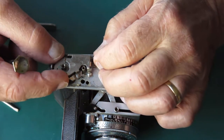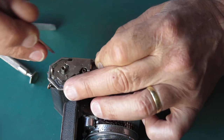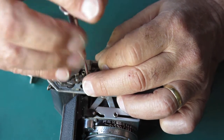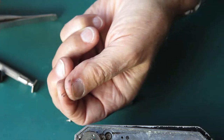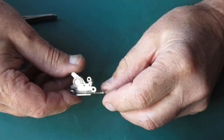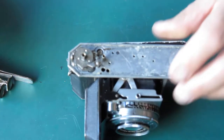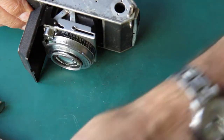Let's pull that back so I can get to the three screws that hold this bracket in place. That screw head looks a little bit damaged and it's loose. There's a shoulder screw with a return spring on it which I have to carefully gather up because they're easily lost. This is a bit gritty — there's a lot of impacted dirt here. I don't know whether there's any damage to the teeth, usually not with a camera like this. That little latch mechanism can come out and there should be a spring in there — and there is.